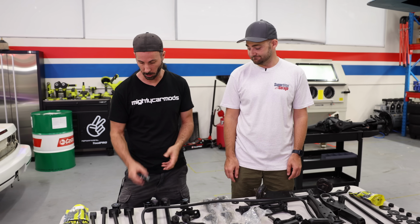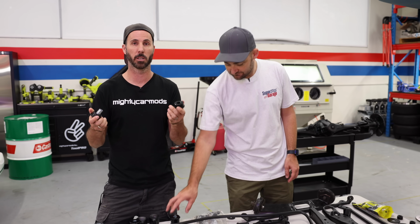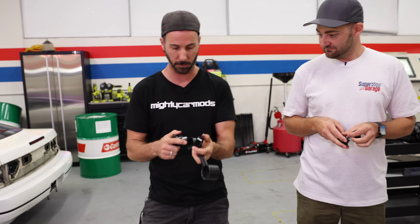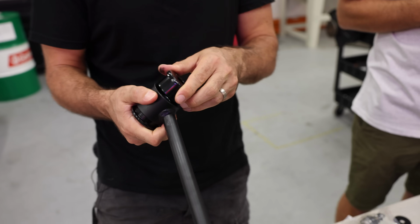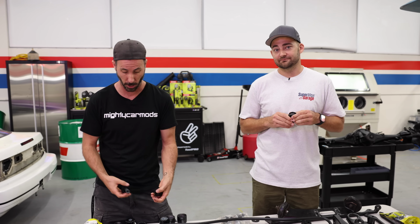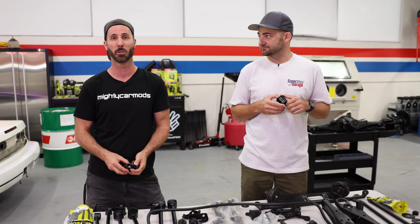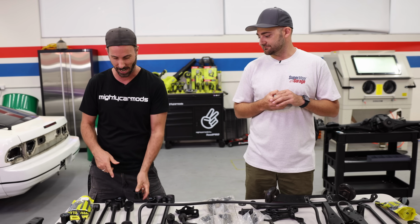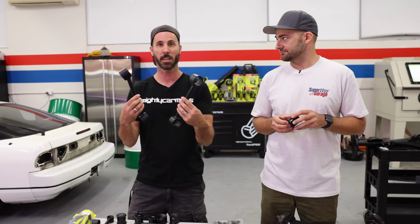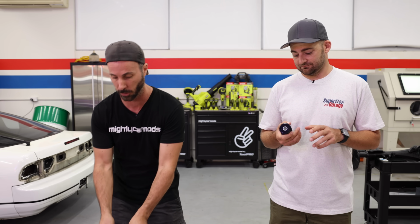So we're changing all of the bushings to white line bushings. These are a two-piece, so while the old ones had to be kind of burnt out and melted out of place, these ones here, literally a bit of grease on there, and then they are going to go in from either side. That is a relatively inexpensive way of totally transforming the connectedness of all of the different components of your car, because over 30, 40 years, rubber deteriorates, it gets hard, it cracks, it's probably been through rain, snow, ice, who knows, and that is just a way of going, you know what, all of these parts here, you can make them like new again, but not the rubbers. So changing all of those is going to drastically transform the experience of driving this car.